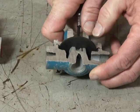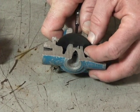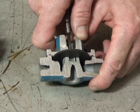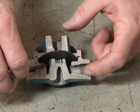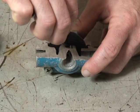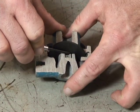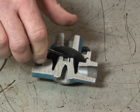And now it allows air to go around the diaphragm here, out to the delivery. When the driver removes the signal from the supply port, suddenly we have a higher pressure air coming back from our delivery circuit. Now that pushes the opposite direction on the diaphragm to seal the supply.